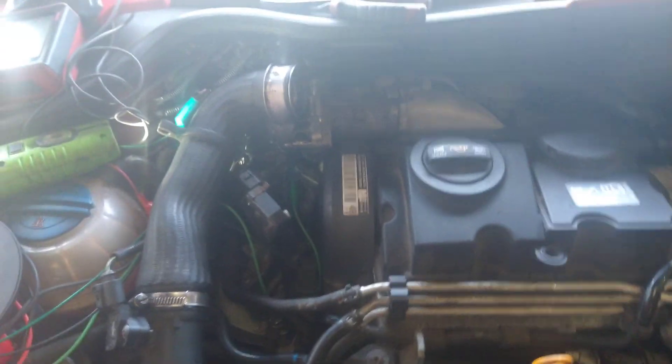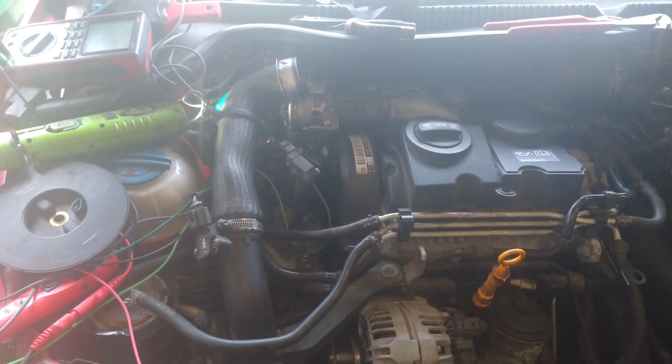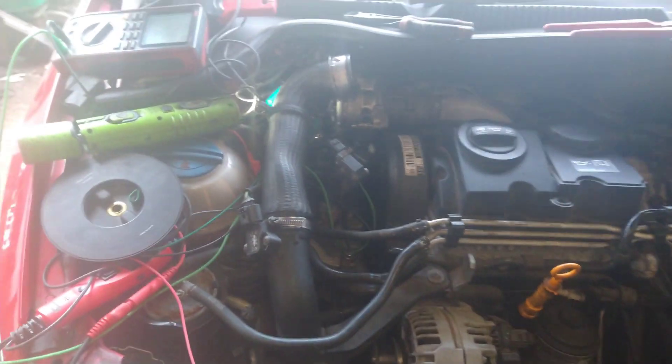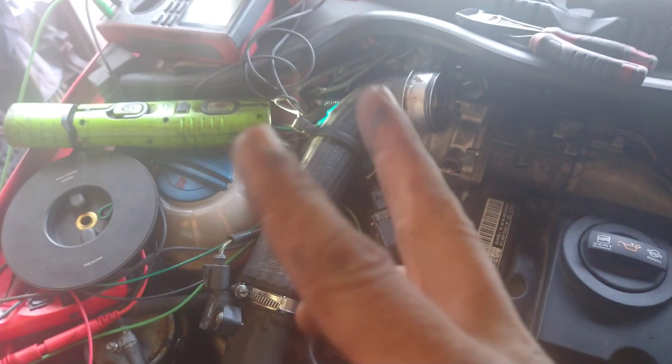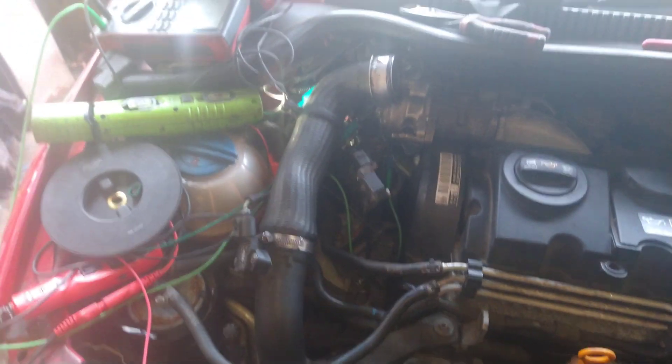So it was a complicated one. It did have two faults: the gears were faulty inside, and the EGR wasn't working properly either - it wasn't moving - so it got a new EGR. But that was mad to think those wires needed swapping over; I didn't expect that. It was an interesting one. Just got to join the wires together properly now and clear the fault code. Thanks for watching.